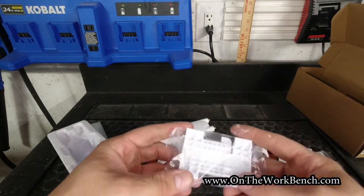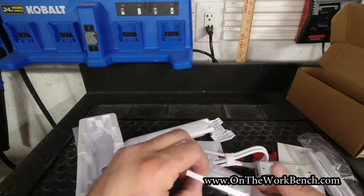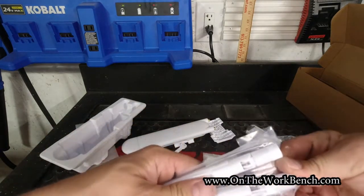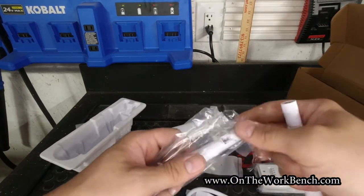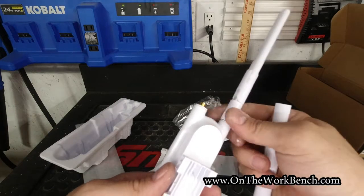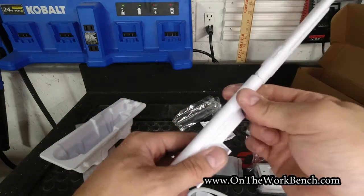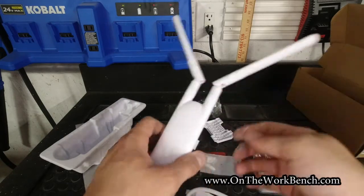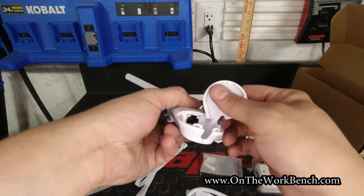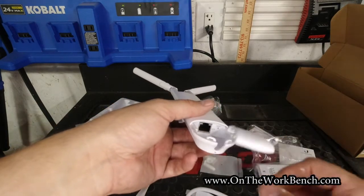This adapter is actually curved on the back so you can get it around a pole — you can see it gives at least a little curvature to wrap around. The other mounting plate is intended for flat mounting. This unit is rated for outdoor use, so you can place it outside on your property or inside a garage even if it might be moist. We can screw the antennas on just like a pair of rabbit ears. At the very bottom there's a little trap door with a port where you connect your ethernet cable, and it's powered by power over ethernet.